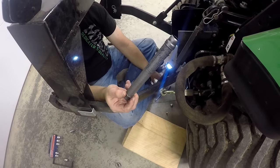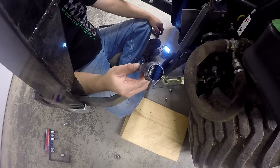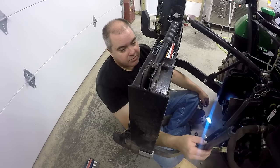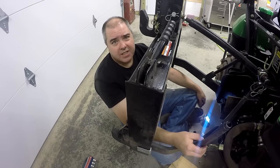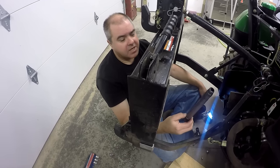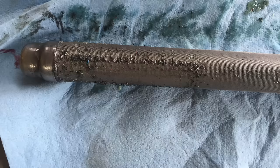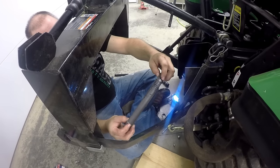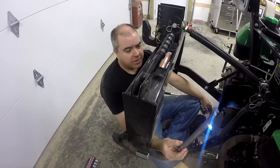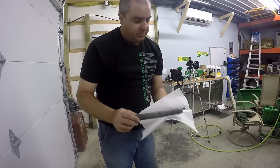There's what it looks like. We don't replace that whole part — we just clean it, and it's actually got a magnet in it. See the magnet? That's what attracts all the metal shavings to it. We'll clean all these shavings off and actually take that magnet out. The shavings come from a lot of times the initial manufacturing and then from wear on the gears. The tractor's got 191 hours on it and I did this at the 50-hour mark. It looks worse to me this time than it did at 50 hours, but it's been a lot more hours. That's actually why they have you change it at 50 — to get the break-in debris out. The magnet design is probably just cheaper than making the whole part magnetized. So it'll be interesting to see how much got through to the inside.